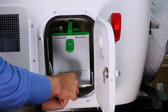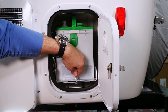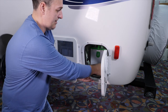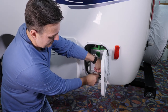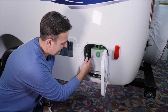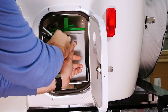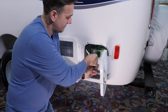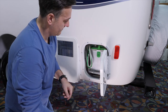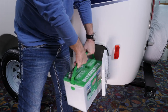To remove the battery, remove the wing nut and there's a little bolt — just make sure you don't let it drop all the way down in there because it can be tough to get out. Lift this plate off and bring out the bolt and set those aside. We made the leads to the battery long enough so it will come all the way to the ground. Remove the little velcro retaining strap — it's reusable, so set it aside. The batteries are heavy, so use two hands and ease it down to the ground.